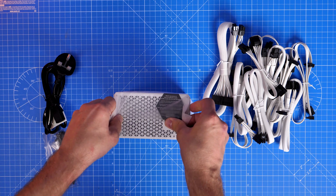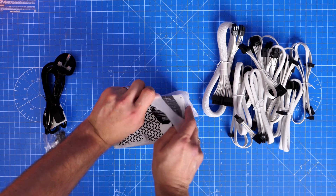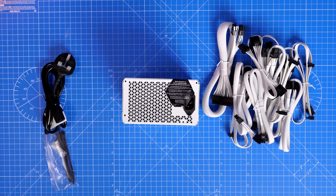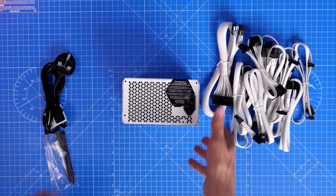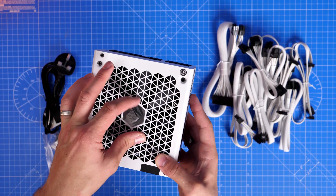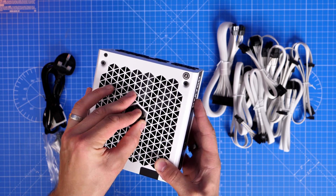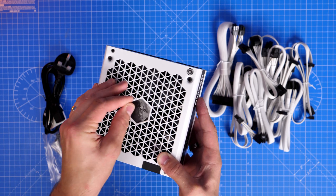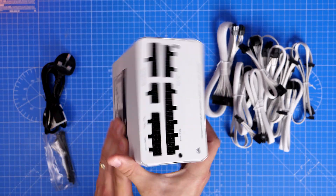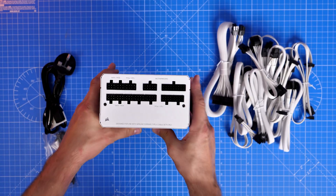This will vary depending on your motherboard and graphics card, so it's worth bearing that in mind. If you're not sure on the wattage of PSU you need, check out the link in the description to the PSU calculator, which allows you to work out the right size. This is a 750-watt unit — you need to make sure you have the right power supply for your components. This is a modular power supply unit, which means you only need to plug in the cables you need, which is great for cable management.